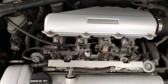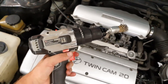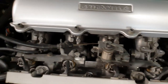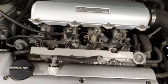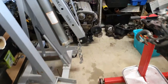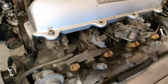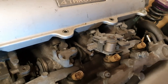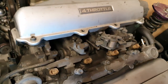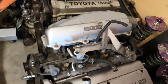Another thing to make it look a bit fresher is I used a little toothbrush with metal bristles and went all around the throttle bodies and the tight gaps, and then for the rest I just used my drill with a wire wheel attachment and stuck it in all those areas. Way cleaner, really nice compared to what was there - all dark with oil residue and corrosion. It makes a huge difference - just the little finer details.